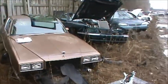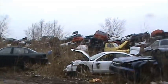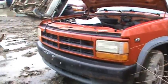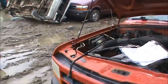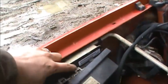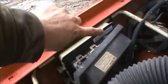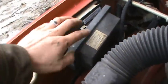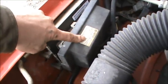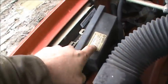All kinds of derby cars, newer Chevys, a little bit of everything. These older Dakotas have the ECM in the passenger side fender under the hood, and the numbers are always printed right on there. I go by those — it's just three 8mm bolts to take it off. Now if it has an authorized software update, you have to go by that number on the list because it's been changed to that number.